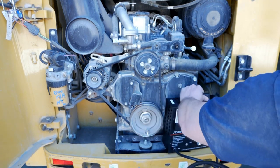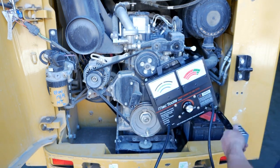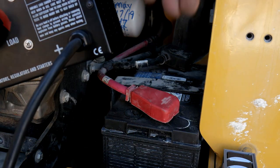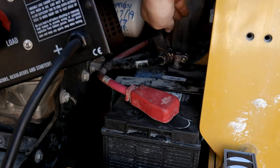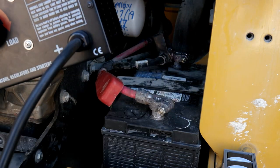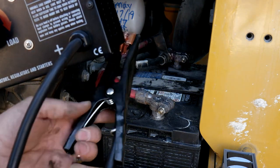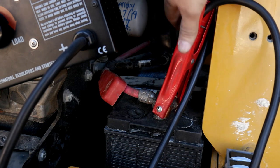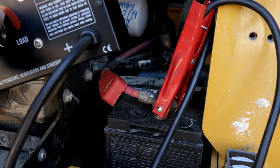We're going to need a carbon pile, so we're going to grab that and gain access to the battery terminals back here. We've got to lift up the rubber boot — it's always a good time to inspect your battery while you're at it. If you're having a cranking system problem or a charging system problem, commonly you'll find a corroded or dirty connection that you're going to have to deal with.